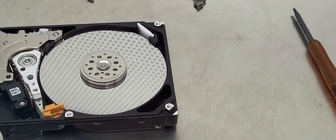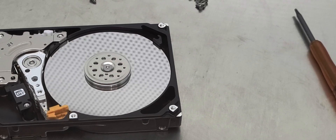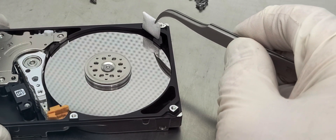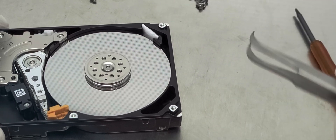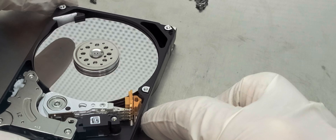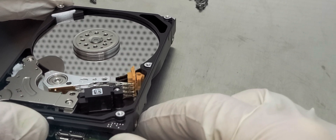I'm not observing any kind of scratches on this. Let me take a look at the filter. I can see some minor stuff that should not affect the functionality of the drive — that is a good sign. So this probably would be just a head swap, and we don't need to disassemble the platters to address the issue. But we're still going to inspect the heads under the scope and see what's going on there.